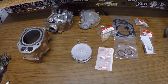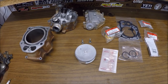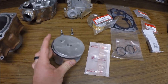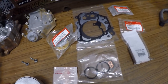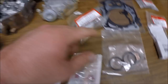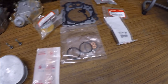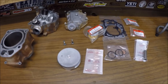We're ready to get everything assembled. It's all pieced back together, everything is to spec — fresh 25-over bore with the piston, factory piston, rings all new, ring clip already set, and the head is completely rebuilt with new valve springs, re-lapped. The top end gasket set is Honda OEM — it's way cheaper than piecing everything together. It's got all the o-rings for the boots, the two copper washers, head gasket, and base gasket. Definitely look at that if you're doing the top end, along with the bottom end gasket set, new wrist pin, and clutch nuts.